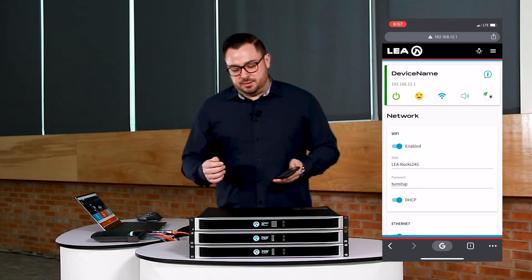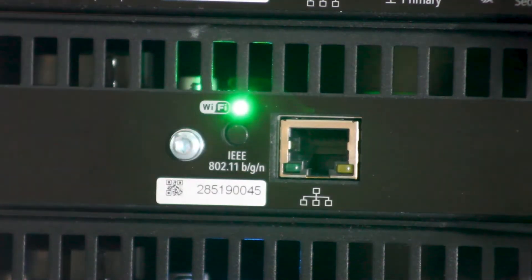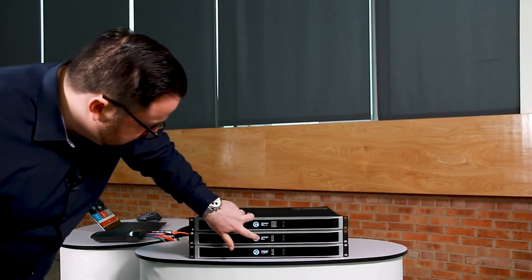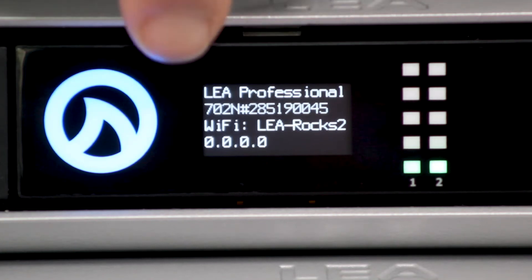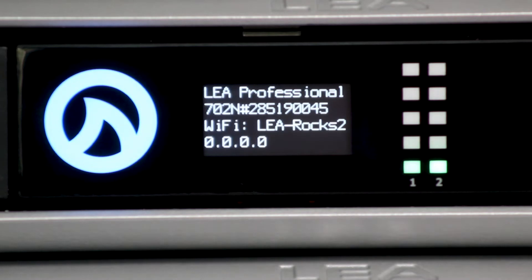So there's one more step we need to do, which is to push the Wi-Fi button on the back here. This will change this amplifier from AP mode now into Wi-Fi mode. You see the green light come on, which means it's now in Wi-Fi mode. And what we can do is come around and check on the front screen here — we see that it says Wi-Fi. The access point now just popped up, and it should get an IP address in just a second here, and then it will be fully connected via Wi-Fi mode.